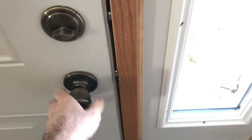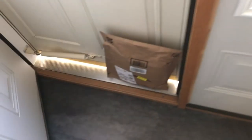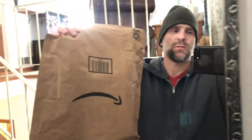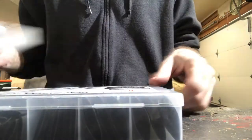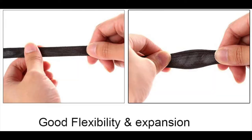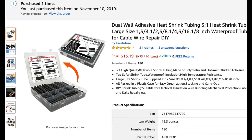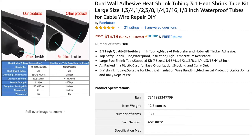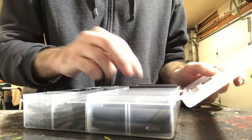So I had my fuel hose, but I wanted it to be braided like the original. So I came up with this great idea. Straight from the jungle, I went online and I ordered some of the cable covering that's made to protect wires or hoses. And that's the braided sleeve. Bought a size that I know would fit the outside of the hose really well. And then I threaded that stuff over the hoses. And after I had that threaded over the hose, then I used heat shrink wire shrink, and I sealed the ends of the braided covering with that. And it worked pretty dang good.